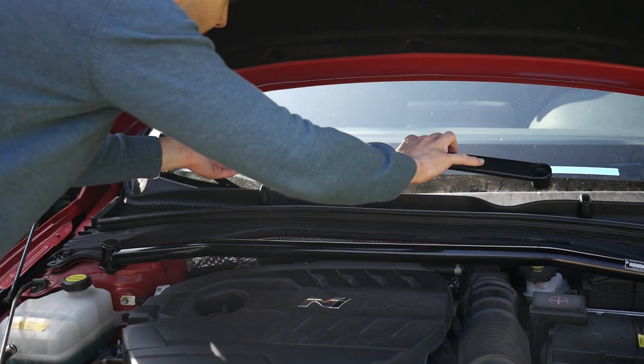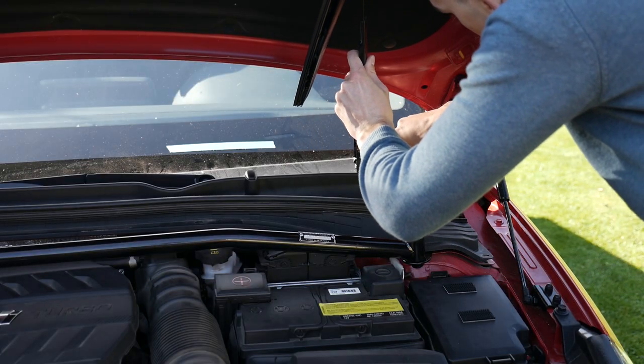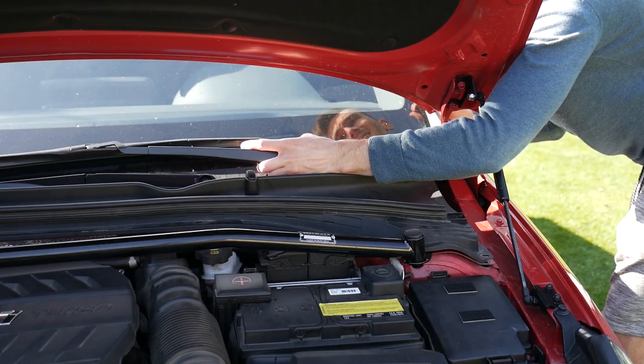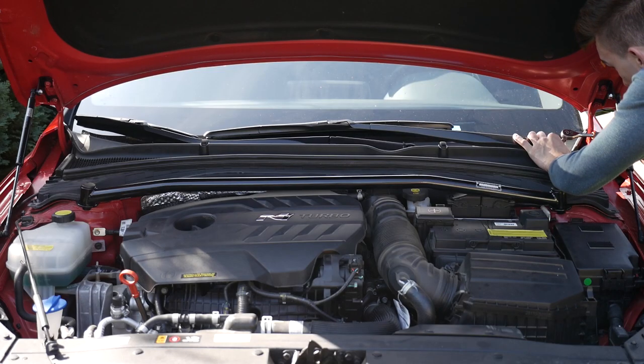I originally intended to push the wipers to the very bottom, but technically, it doesn't exist. So the wipers fit perfectly and automatically to their lowest position. That's why any brute force is unnecessary and you should really focus on the wipers' alignment.